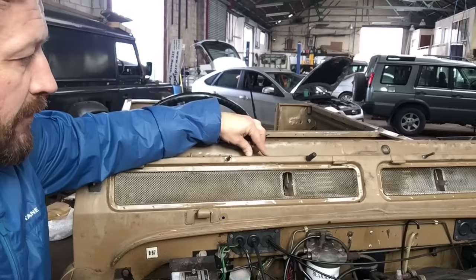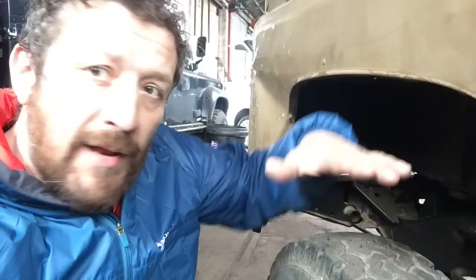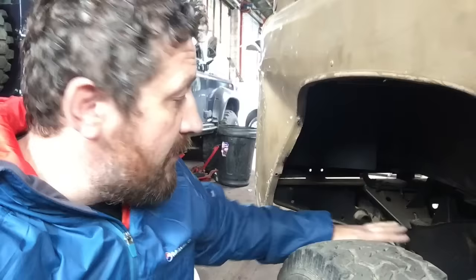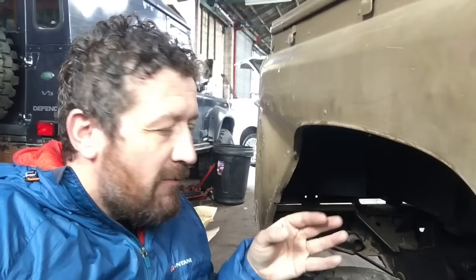A lot of Defenders can suffer really badly from corrosion on top of the bulkhead just below the windscreen. There's a foam strip between the bulkhead and the windscreen that can trap water, so you'll find corrosion all in here. With these flaps lifted up you'll be able to see underneath to check for corrosion — it's repairable but it does cost money. The rear crossmember is another key area. With a wheel arch covering it, take a torch and have a good look. It's replaceable, but watch out for a bad job or someone trying to cover something up with fiberglass or wax oil.